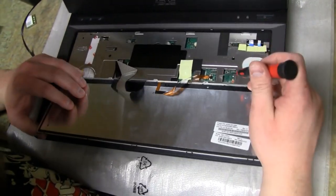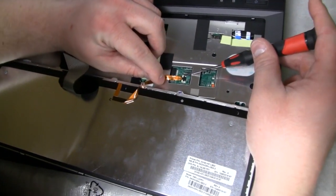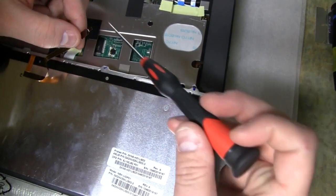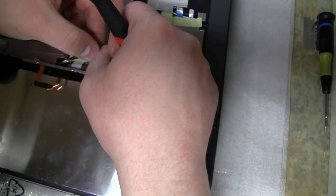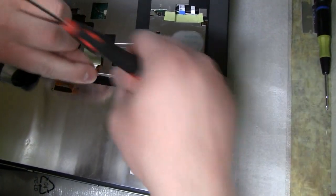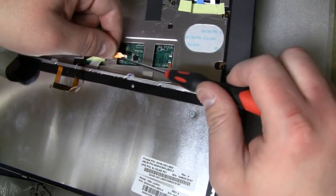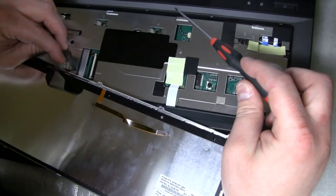The next step is to remove a couple of these ribbons. This ribbon controls the backlighting. When removing it, press on the top and then the bottom, then slide it out. Pay special attention to the direction the little metal strips are facing. Flip it over — you've got nothing down here, and because of the way the tab is set, it might look like you should put it back in one way. However, it wasn't installed that way by ASUS. Some will have the metal strips facing down and some facing up. So when putting it back in, make note of that because your backlighting won't work if you don't put it in right.